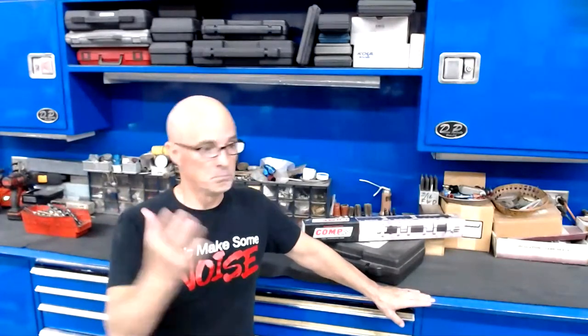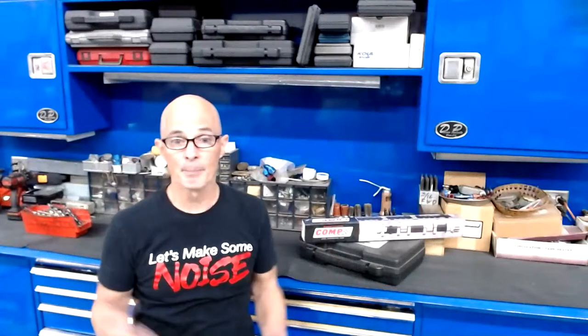We're going to look at this both ways. We've got a couple of big blocks sitting here, so let's take a big block Chevy, and we'll look at this in reverse first. We'll put a big camshaft in. Let's say we have an 8 to 1 big block. It's going to be a blower motor, so it made it 8 to 1.